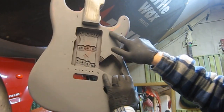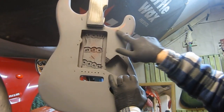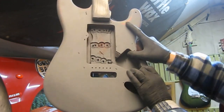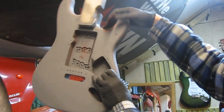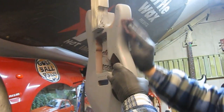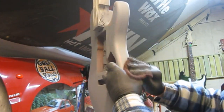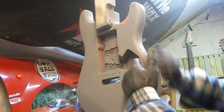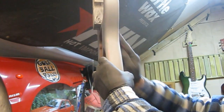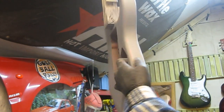But I will blow a little bit in there, add a little bit of repair, so I'll just knock that back a little bit. I don't know if you can see that on camera. Yeah, there's a little scratch there, I'll knock that back. So now, like I said, I'm going to go over the whole thing with this red scotch bright, just to make sure it's all keyed up, there's no shiny patches, and then we'll give it a really good clean with the window cleaner and the solvent degreaser, and then we're ready for base coat.